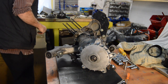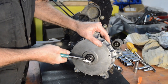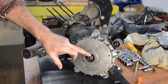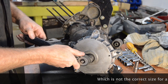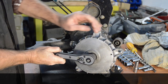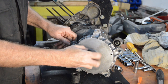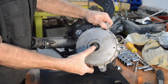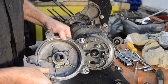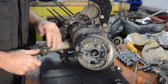We'll take the drum off as it's all going to come apart anyway. That needs the split pin removing. The clutch nut is 24mm — I don't know where I got 19 from. Let's see if we can get it undone — which we can. Remove our drum. Deep washer. The drum's in good condition, splines are in good condition. There are our brake shoes, which also look to be in good condition.